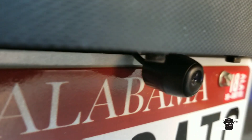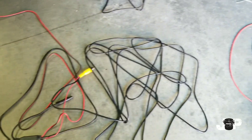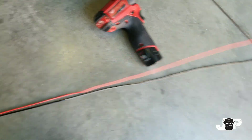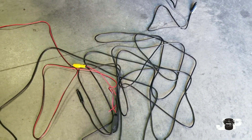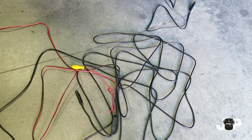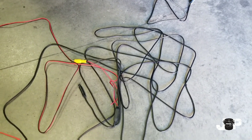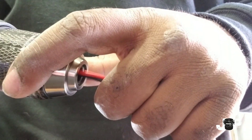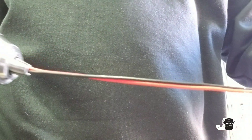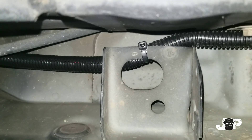I'm not gonna show the tab but I already got the backup camera mounted, got my wire hanging down right here, and now I need to run this wire. I got some red and black primary — gonna twist those two together because we're gonna tie this camera up to ignition, that way the camera comes on as soon as the car comes on. Then we're just gonna find the reverse trigger inside the cab, maybe at the BCM or something like that, to trigger the monitor itself. Let me spin these wires up real quick.